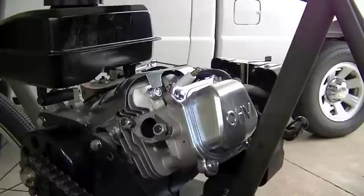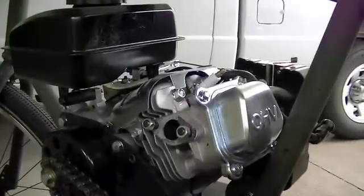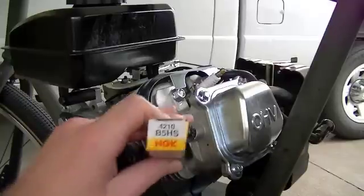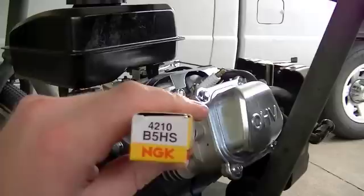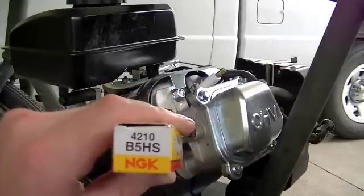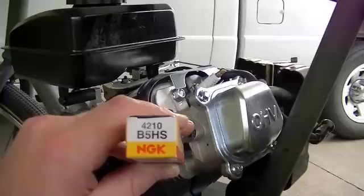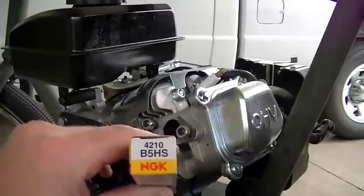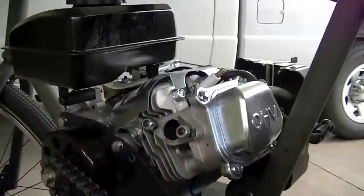Through the magic of editing it seems like I was not gone at all, but I was gone for about an hour doing some research online and at the store. It doesn't appear that E3 has a spark plug that's compatible with this engine. So I went back to the auto parts store and got the NGK B5HS — that's NGK's part number; the store part number is 4210. Check with your local auto parts store before buying online, as they quite likely could have it. Like I said, I had that 66cc 2-stroke bike engine before, and this spark plug was a considerable improvement. So we'll give this one a shot on this 4-stroke Harbor Freight engine.